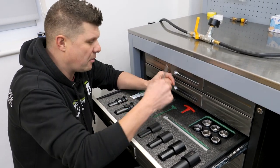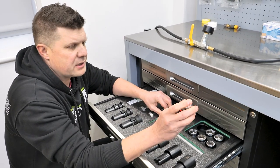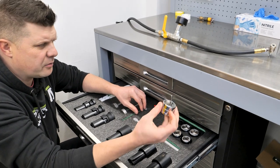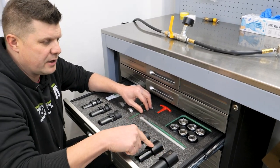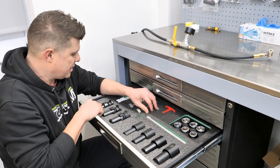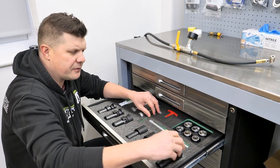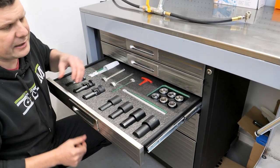If you're doing this at home this is probably a little bit overkill. We have flat sockets for working on the top of forks, and Delrin drivers in all our major sizes - 32, 35, 38, and right the way up to 40mm for the big downhill forks.